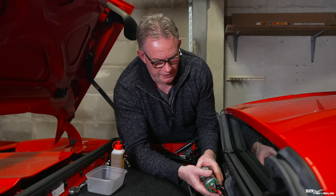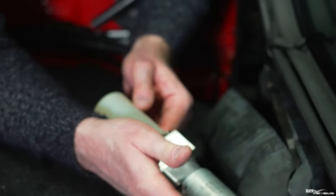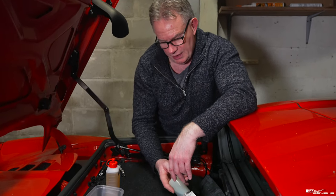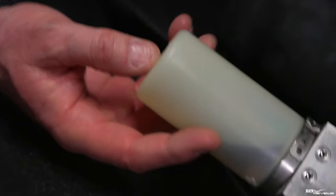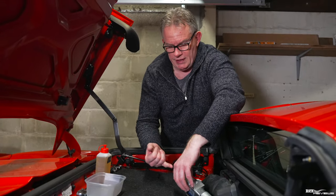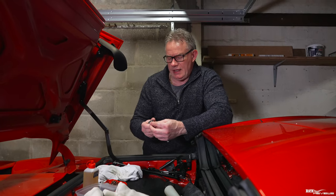You've got to be a bit careful how you deal with this, but I think I should be able to just ease it out and empty the reservoir. The reservoir fill and empty hole is a little allen key at the back of the reservoir. This is not widely advertised - I've worked that out by seeing how previous pumps worked on earlier Ferraris and how this pump is used on other cars. First of all we need to remove the allen key plug for the fill hole, then drain out the old fluid into our container.